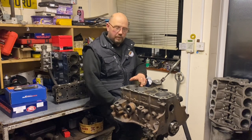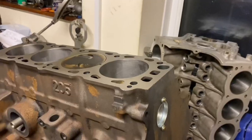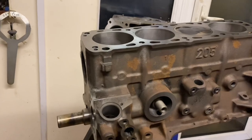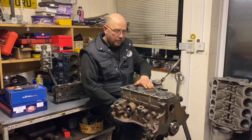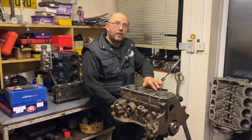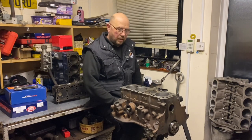What we have here is a fresh 205 block newly bored to 93mm. Sitting in it is one of the original pistons. It might get a new set or it might just get the original damaged one replaced, but for the moment I've just used one of the old ones. The block's been faced and the good thing is that with the engine at TDC the deck height is actually the same as the old one, so I don't need to adjust piston height or conrod length.